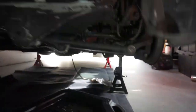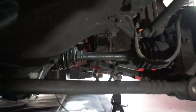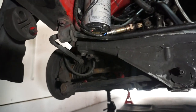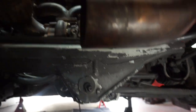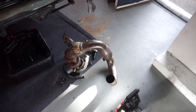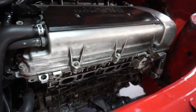I'm gonna buy new axles. On the passenger side is the '03 axle, and on the driver side is the original axle — it's smaller. The '03s are better; they're actually bigger. So we're going to get the upgraded ones. Let's get the turbo off. Turbos off — got all the 14 millimeters on the back of the 2zz off.